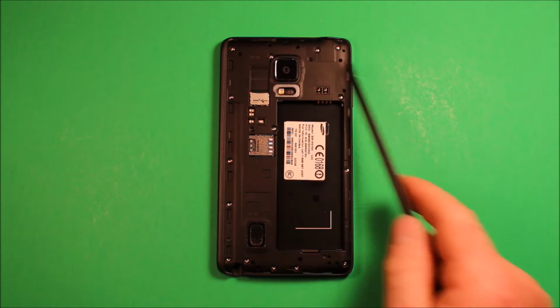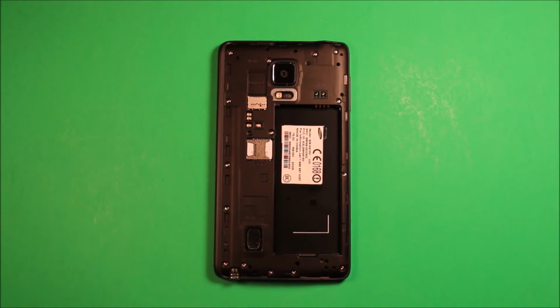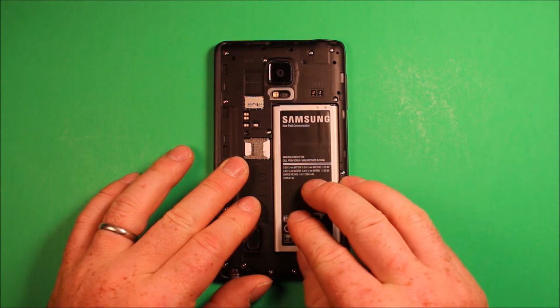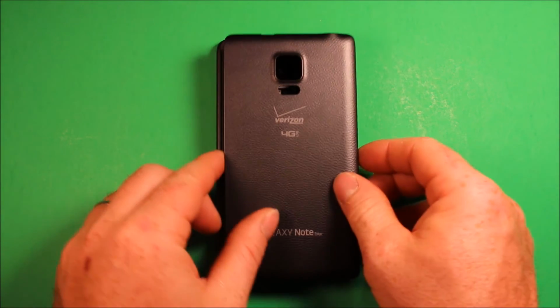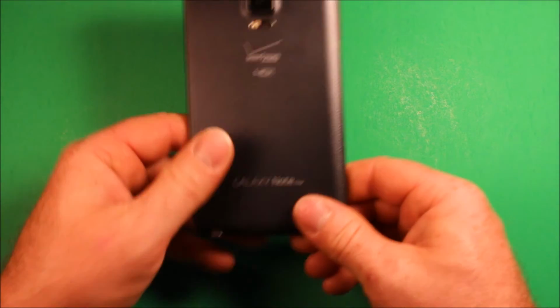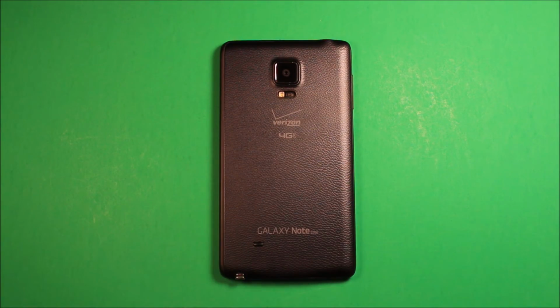So now that we have all our screws back in, if you have anything to put in like your S Pen or your SIM card or memory card, go ahead and do that at this time. So next, grab your battery and use the connectors on this side, and on this side you can line it up. It only goes one way. Just set your battery down in there and put your back cover back on. Just grab your back cover, set it down on there. Just work your way around all the way down. And you're all set. Thanks for watching.